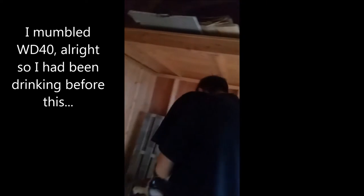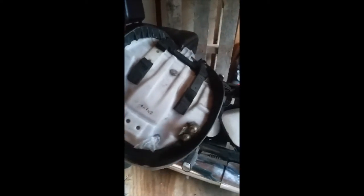Your first step is to take off the seat. There are two bolts on either side of the seat right underneath here that are going to come off. Your seat will then lift up, pull back, and come off.